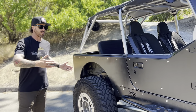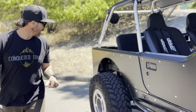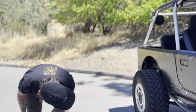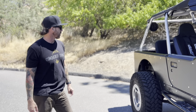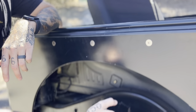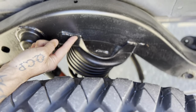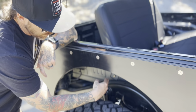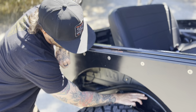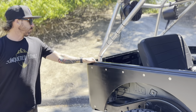I'm not sure about the exhaust — I think it's aftermarket, but the guy we bought it from didn't know everything since he also bought it from someone else. Drivelines are 1310 U-joint style aftermarket drivelines. One thing we want to address at the rear: by pushing the axle back with the long arms, the coil bow is significant. We'll either put coilovers on — weld-in towers — or use a Genrite piece that moves the coil bucket back and levels it out so the coil isn't so bowed.